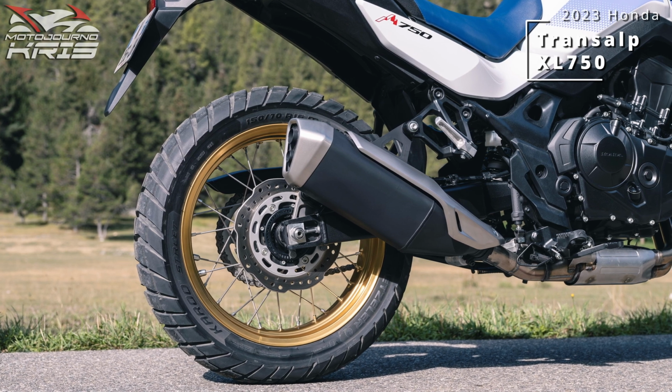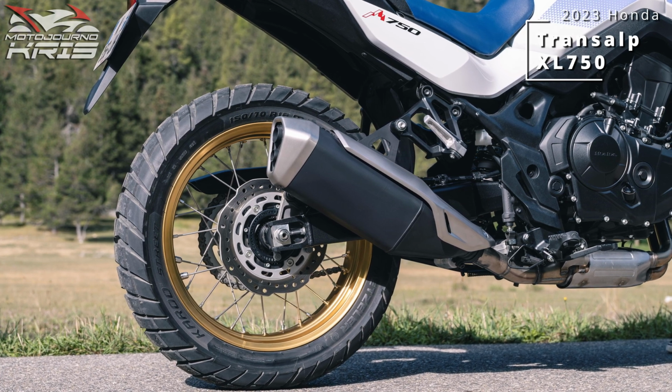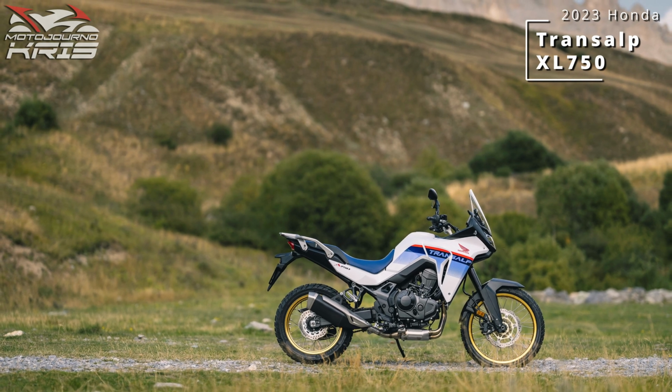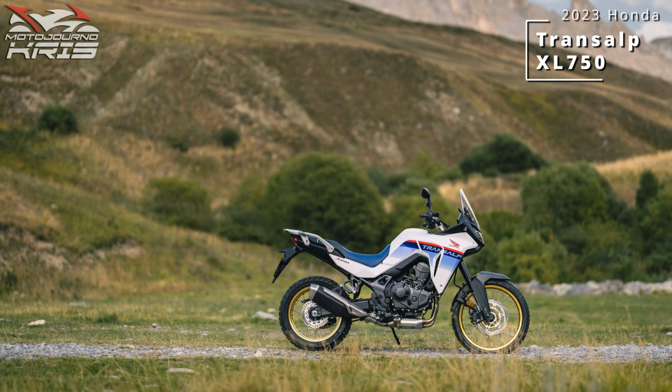A steel diamond frame is run, weighing 18.3 kilos, which Honda says is 10% lighter than that on the CB500X, which isn't exactly a light machine. However, the other point they mention, strength, is probably the more important one. The integrated heavy-duty subframe is also steel, but mainly hidden away under that bodywork.